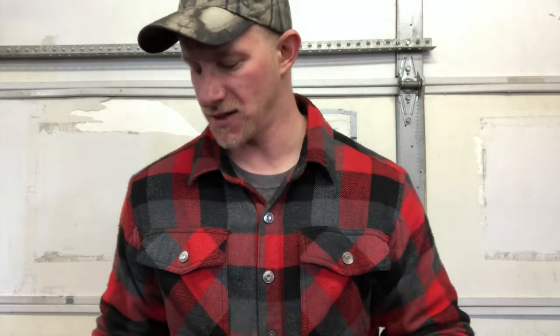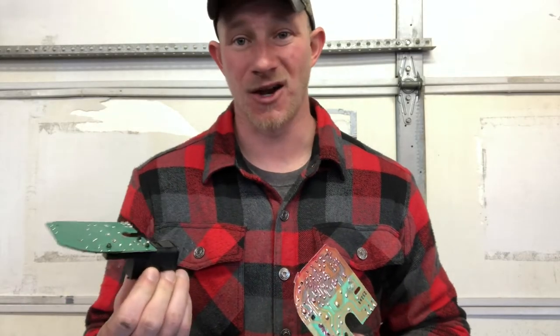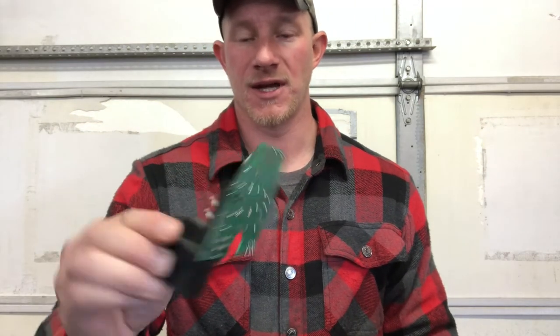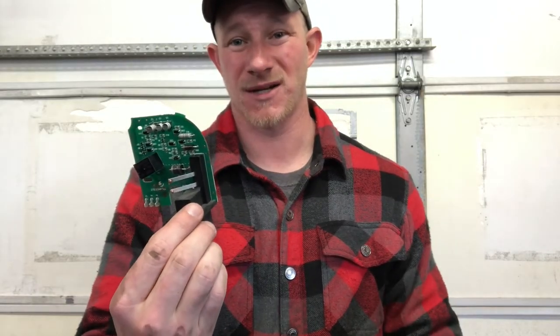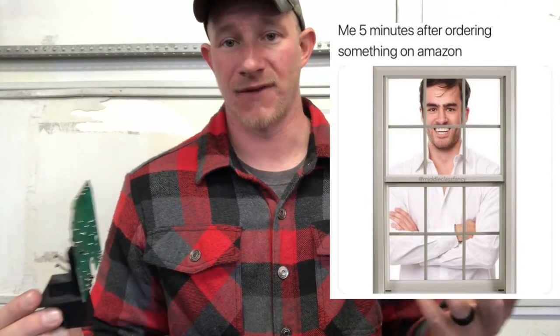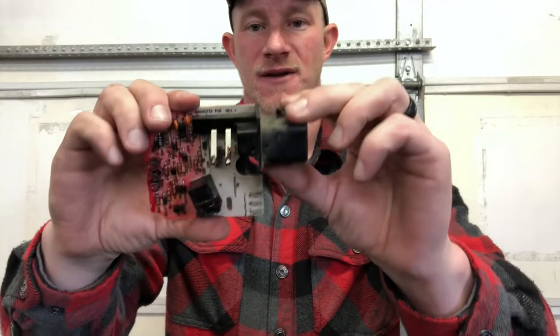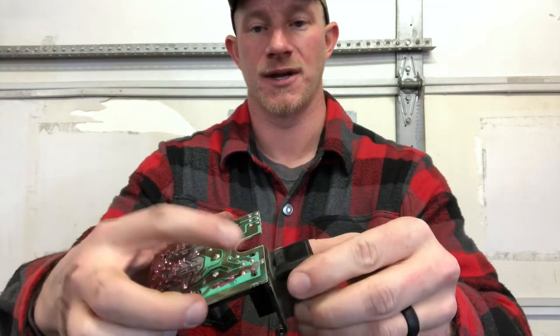What I suggest doing is, no matter what the problem is, you can get a brand new one for like $10. I got this off of Amazon — I'll put my affiliate link down in the description below so you can get this for your own truck or vehicle. I think it's around 10 bucks, so you really can't go wrong. And because it's Amazon, you're going to have it like that. The main reason why these solder points tend to break is there's a lot of tension on this plugin here, and it ends up just wearing down and cracking these.